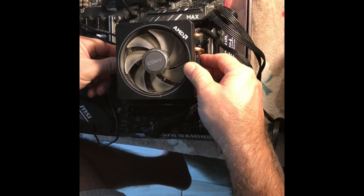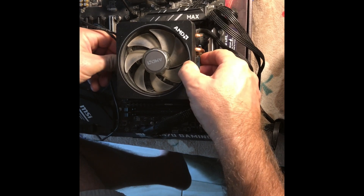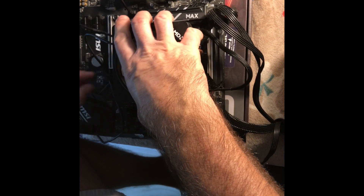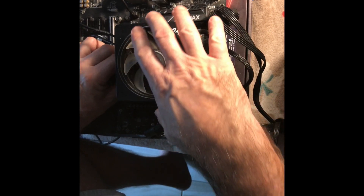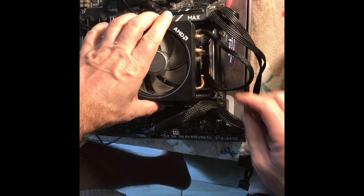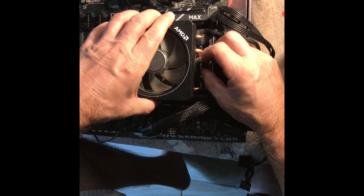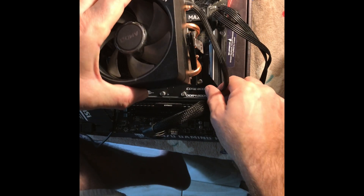What you want to do is remove this cooler assembly from the CPU, which is attached via thermal paste and brackets. Remove the bracket on the right which is holding on to the clamps. The clamps hold on to the brackets on the motherboard — just loosen that lever and wiggle, wiggle.